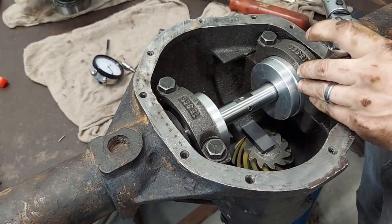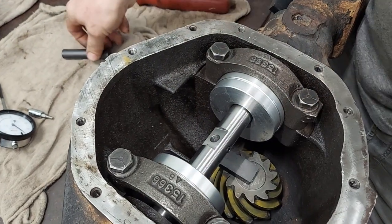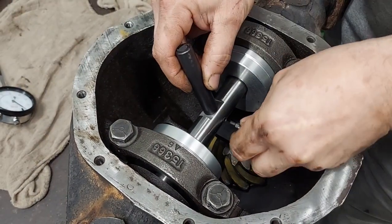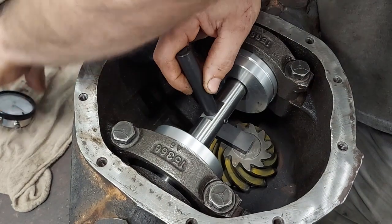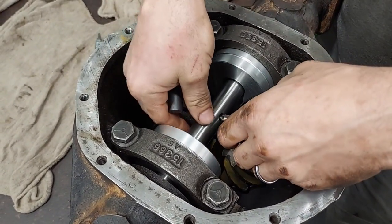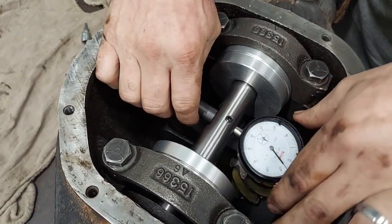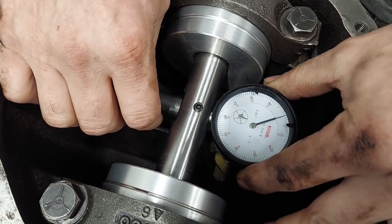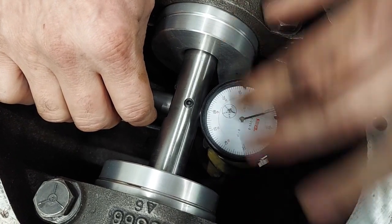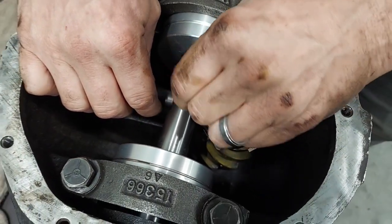Now you're going to measure off of this flat surface, and this spacer is going to set the dial to 3.375. You're going to have a set screw — put the dial in and you want to make sure you get close to zero. You can always add back the numbers. I'm going to set it to zero. As I push it in, okay it's hitting — we're at about 10 thousandths. I'm going to try to stay... that's at 1 thousandth, so we can add this back after we do our measurement because I pushed it in 1 thousandth.